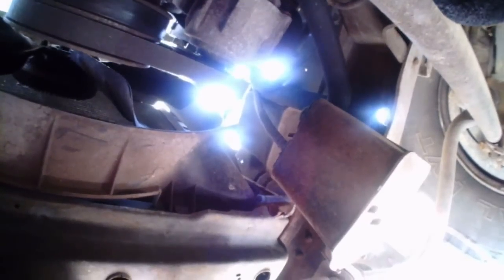Okay, so on the side of the radiator is a little valve to drain out coolant, and I have a hose that I'm going to put on it so it doesn't squirrel all over the place, because it doesn't have a clean path down to under the truck. So this is a little different view. As you can see, there's the valve with the hose hooked up to it.